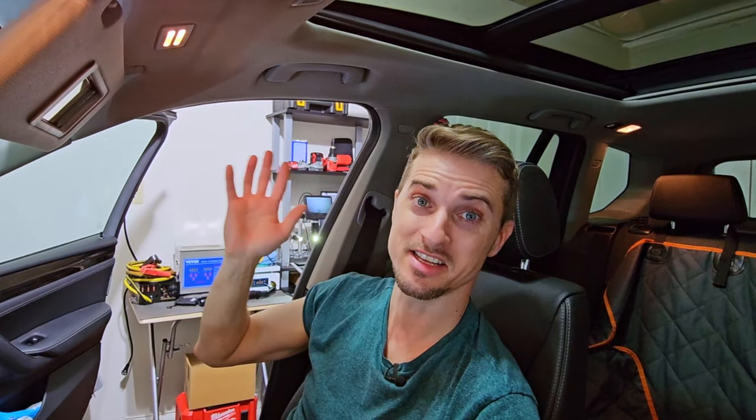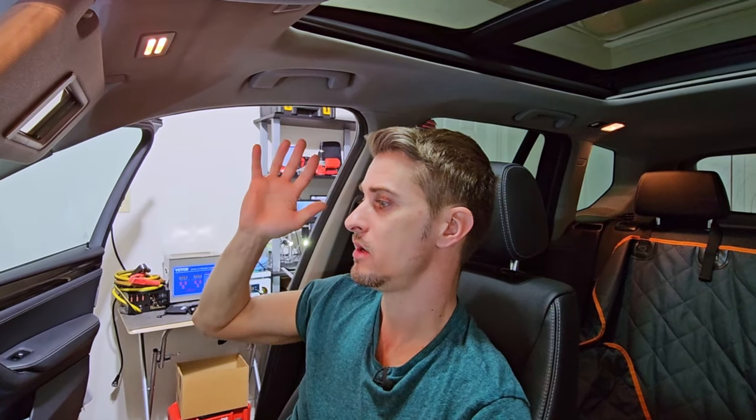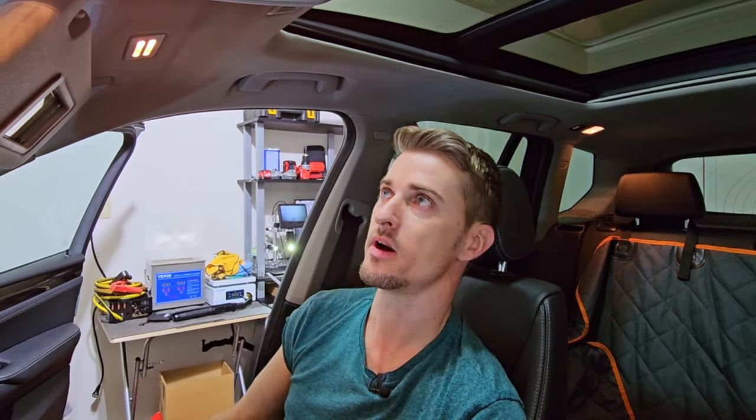This was one way in which I clean the drains for the sunroof. Of course, depending on the model of the car and how heavy the clog is, I can use different methods, or in a worse scenario I need to remove the headliner. I want to warn you: please don't use compressed air to clean these drains, because if the drain is heavily clogged at the end you can disconnect the hose from the frame of the sunroof, and in that case you'll need to remove the headliner to connect the hose back. I hope you learned something new from this video — if so, show me by hitting the like button. Thank you for watching and until next time, stay awesome, bye!